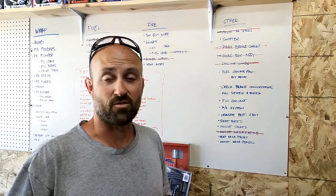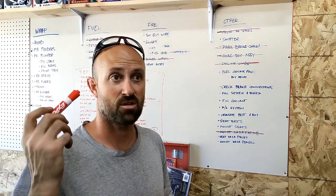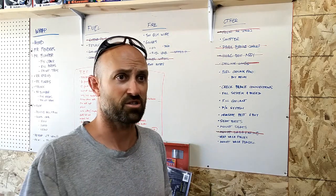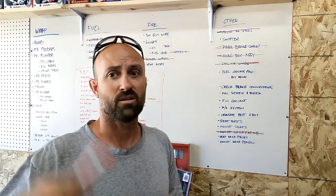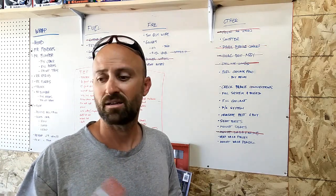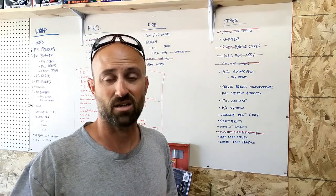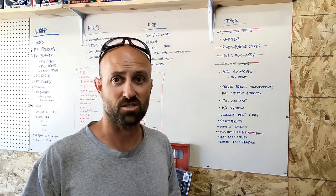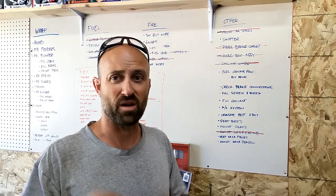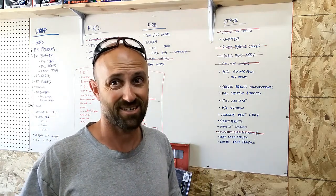So the things I have to do now is really get the clutch bypass switches, so you know there's ignition comes down in, and then when you push the clutch in, basically it allows power to go through. That will start the car and go to the ECM and some other things. So I've still got to do that. It needs to be lengthened from the passenger side over to the driver's side to be able to hook the clutches. So I'm still working on lengthening those out, and those will get pulled out of the bundle. So the bundle is constantly just shrinking wire by wire until none needs to be done.